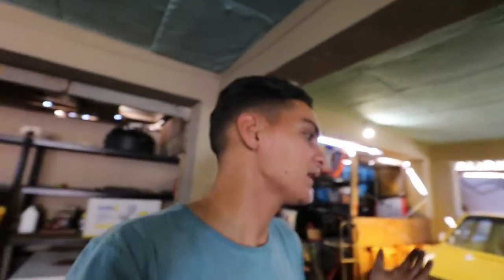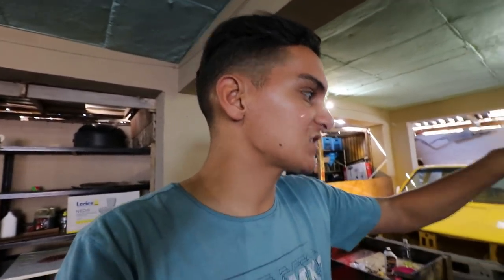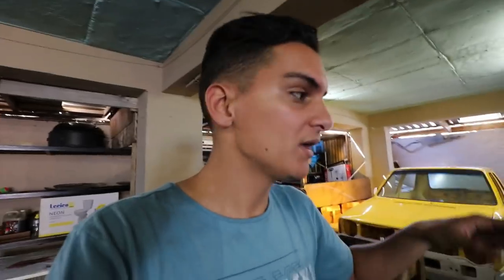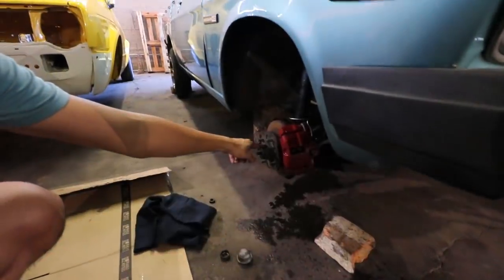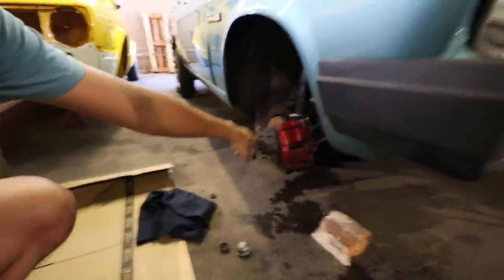All the air came out of the system. We bled the braking system like usual — very basic. The trick is to push the brake fluid from the caliper all the way up to the master cylinder or brake booster with the cap off. Quite clever. We got everything working regarding the braking system, but now we realize the wheel bearings are full of sand and there was never a cap on this wheel bearing. So I'm removing the bearing, cleaning it up and greasing it so the bucky will be a hundred percent when it leaves the yard.